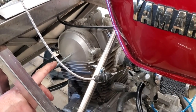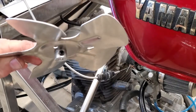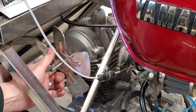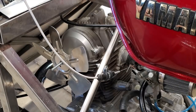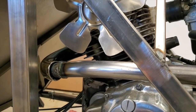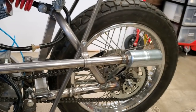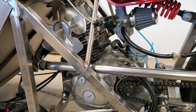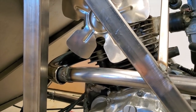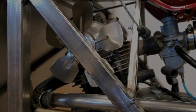You'll notice this shaft coming out of the camshaft — I welded a bolt on the end of it and put a little slot there for an allen wrench. I actually had the fan blades turned in the wrong direction so it was blowing on the motor. I want the hot air to suck away, so I put it in the vise and turned the blades the other way. I also had to cut the muffler tubing to get around the framing — it was double wall with a one-inch interior diameter, which I had in stock. I welded it up and it's going to be four pounds lighter. I'm waiting on muffler fiberglass tape to reduce heat in the engine compartment and I steered the exhaust pipe right underneath the fan so it can also exit heat out as it rises.